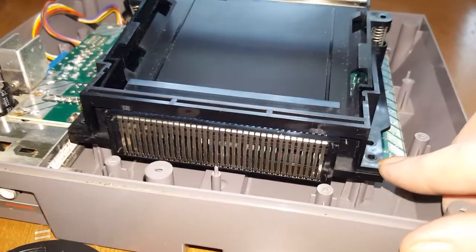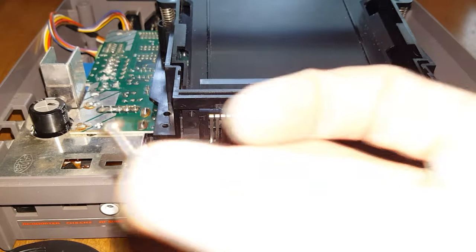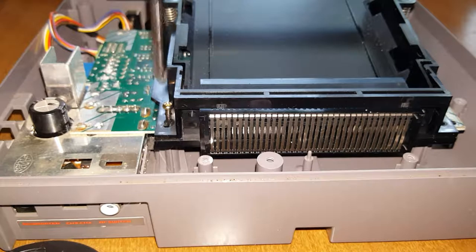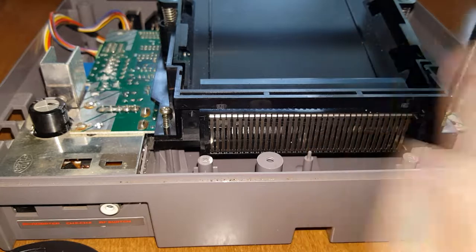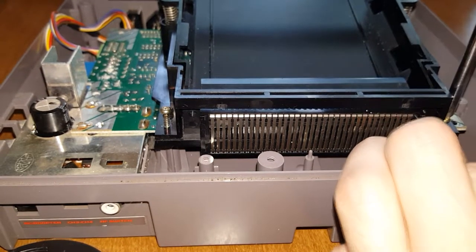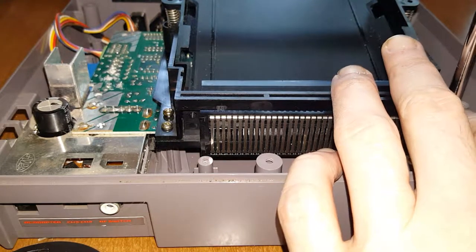Looking at the back edge again, here's where we just reassembled the tray. When you took it apart, you had six screws holding this down. Two of the screws are slightly longer than the others — the longer ones go into the slots closer to the board, since they have to go through three layers while the others only go through two. When you put these in, don't tighten them down too much — just get them in there so it holds in place. The reason you don't want to lock it down too far yet is because you might need to make an adjustment. If it's not in the right spot, a cartridge won't line up and you won't be able to push it together.